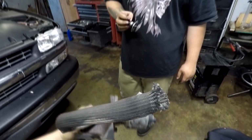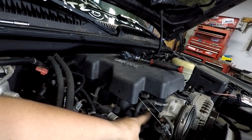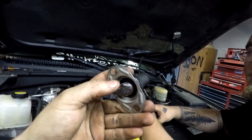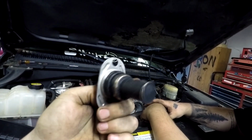So Christian pretty much took this end that goes to the intake. So it goes into the manifold up here. That fits right into the factory spot here on these truck intakes. And you can do this a few different ways. You can get a freeze plug and plug it with JB Weld or whatever. You can get just a rubber seal. I've used bottle caps, whatever you need to do to plug that hole. Or you can do this and you plug it this way and you just cut the old one off, crimp it shut, and I'll probably run a bead over that. And there's our plug.